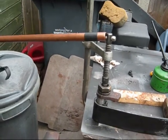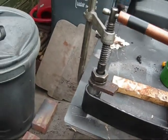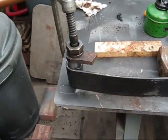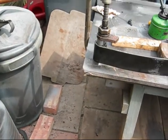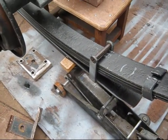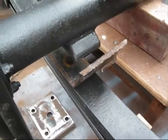My idea is getting in a two-ton G-clamp, a little windy bar, and pulling it in. Put it on there, twist very slowly — it goes in. Looks about right, but it's pounding away with the two-pound hammer just in case. Once you've got it in half an inch or so it goes in square. Then you can see a little tiny jack here under the spring to lift it up, put a brick underneath to give it a bit of height, locate on the pin — don't forget to include that — jack it up, line up the holes, pin it off, and that's it.